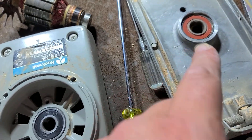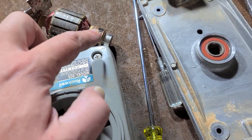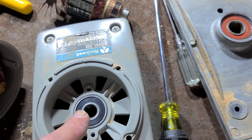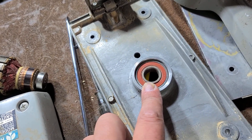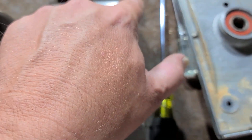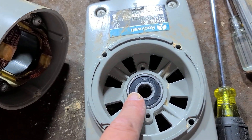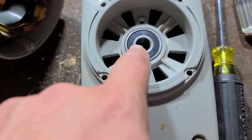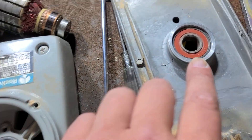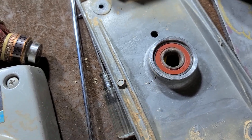By the way, bearings are a 608 for the top, a 6201 for the middle, and a 6202 for the bottom. And the difference between the colors — this is just a shielded bearing up here. Actually it may be rubber sealed on one side, the side that's exposed to the motor, double-sided rubber sealed on this one. It's a little bit more protected being kind of captured in there in between the counterweight. This one is brown because it's sealed by HNBR — just higher grade seals.